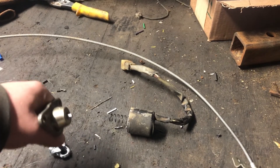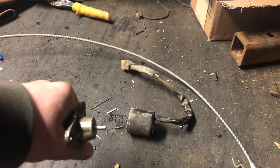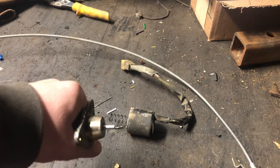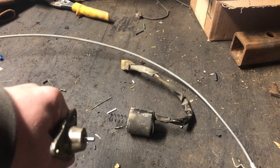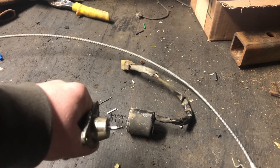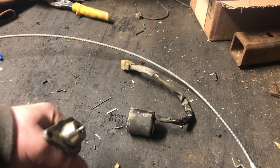The new one was able to pull the pin if I pushed it in and then it would hold it, but when I let the current out it would pop right back out. When you put the voltage back to it — nothing — until you give it a little help. I tried it on the Gator itself on that little Yanmar diesel and even the little lever spring wasn't enough to push it in. I wasn't sure if that was a design feature, but it turns out it's not. So we're going to be modifying some stuff instead.